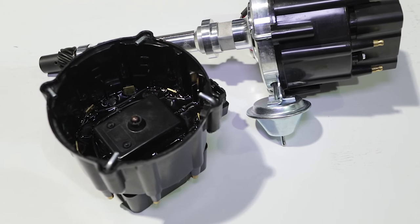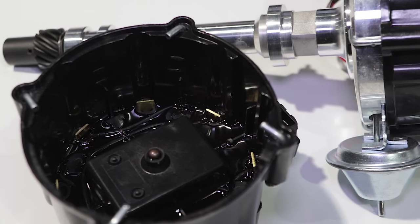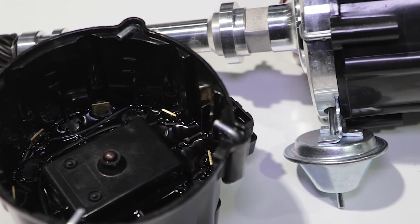Of course, there is a whole new breed of engines which are distributorless coil-on-plug. We can help those guys too. We absolutely can — we've got a new line of LS coils, and we also have the Ford Coyote coils. Those are our newest line. These intensify the spark with a higher voltage output, so it allows you to open your plug gaps up to 65 thousandths. That gives you a better spark kernel and much higher output, so you get better combustion, which yields more horsepower.